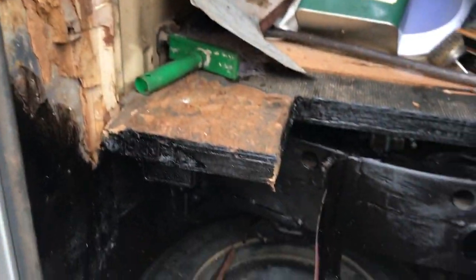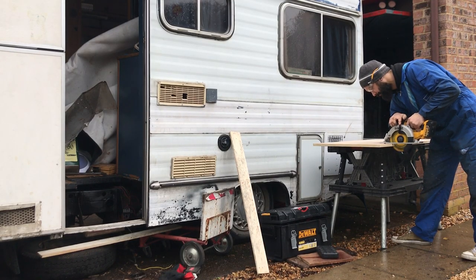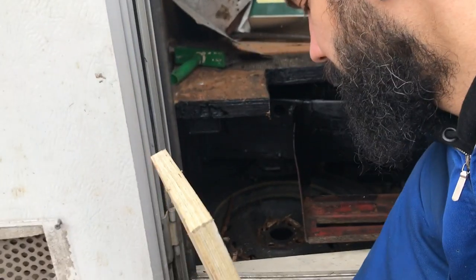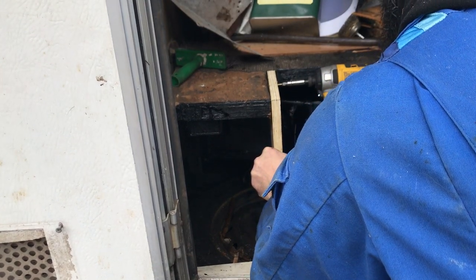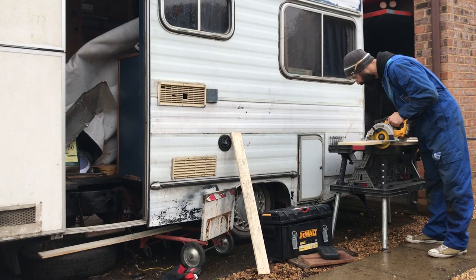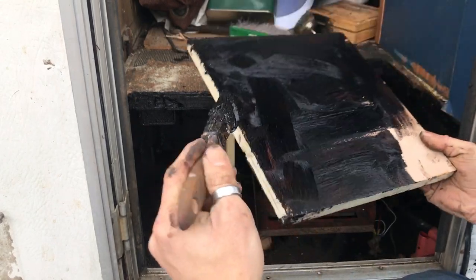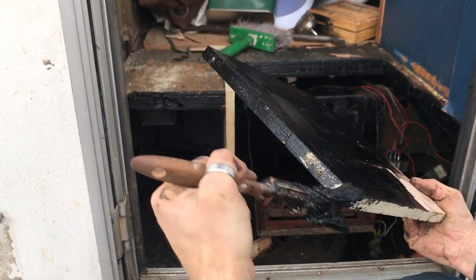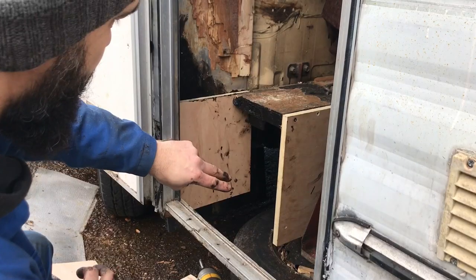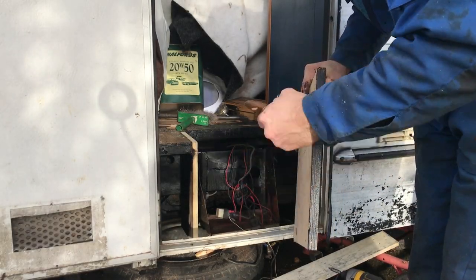I was thinking how to start this — have a side wall which is going to support the front of the step as well. I cut the left-hand side and I just paint the back side and the edge that I'm never going to reach, with an underseal. So I just use some SikaFlex to stick it in there. I've got this panel for the right-hand side, and what I'm doing with this one is just treat the edge.